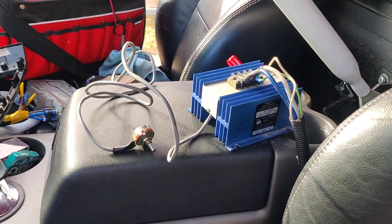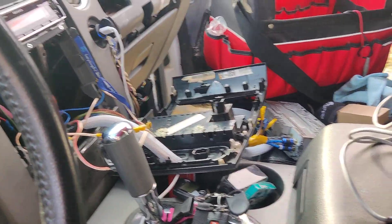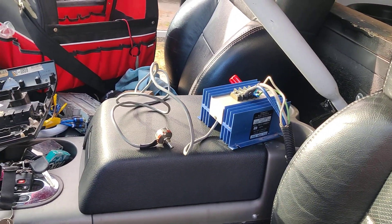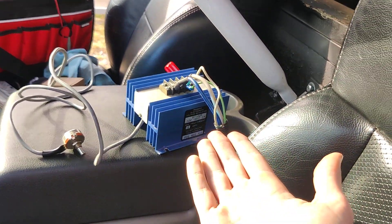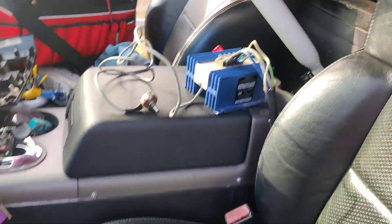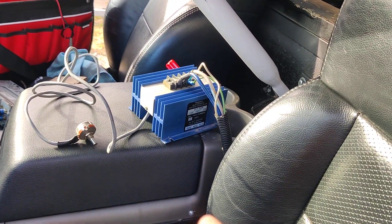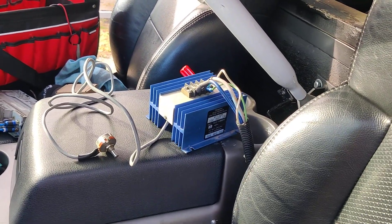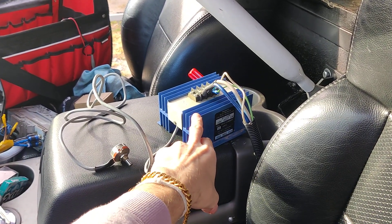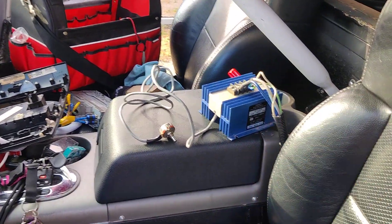Real quick — all you got to do is turn it on with the relay and you should be good to go. This is really simple, only a few wires and that little dial, and it turns everything on. Overall I used to run this in my last build, in my last Jeep — it did fine, had no issues out of it. I would definitely recommend it — 150 bucks if you have externally regulated alts. This will not work if you have internally regulated alts, guys. Let me know what you guys use in the comments. To me this is probably not quite as good as the Brand X, but it is a lot cheaper and affordable. Appreciate you guys for watching.